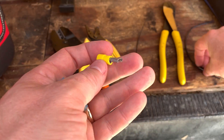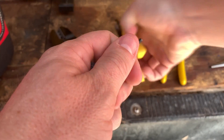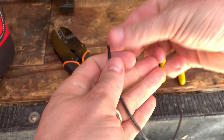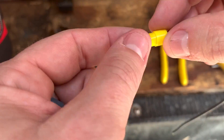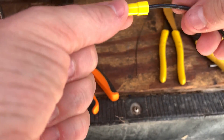I still like it in this sort of case. If you were going to use this wire here, you would strip it back very short, sort of like Caleb showed — only about that far, maybe even a little shorter, then push the wire all the way in against the stop. Now I can crimp here and here, and that will tighten it against the insulation as well, which will make a better connection.